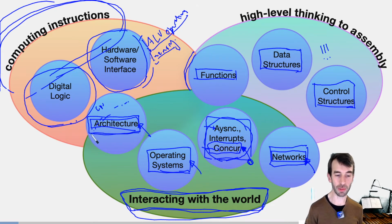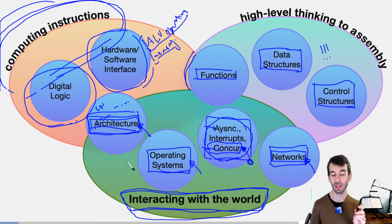The final topic which we did last week, this architecture topic, really brought us full circle, right? We were looking at the diagram of a CPU again, and then wondering what advancements could be made in CPU architecture. And the particular one which was very important was, what parts of a CPU can you duplicate or multiply to make it go faster? So we started looking at multiprocessing, when your CPU has multiple parts that are mirrored or doubled or layered up, and somehow you can either run multiple programs at the same time or make your single program go faster with something like pipelining. And we have a few strategies for dealing with that, which we will get to again here.